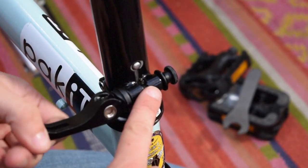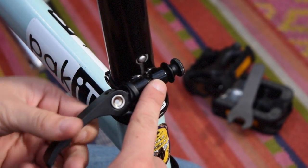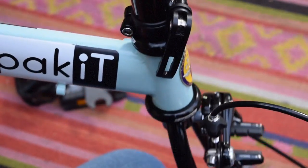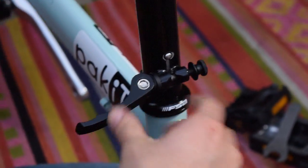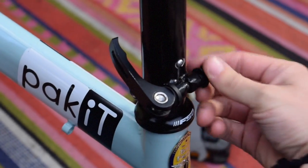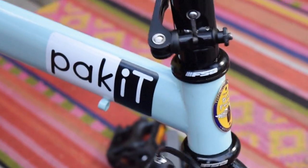Because the clamp is threaded, the direction the lever points will affect how tightly it clamps. Correct lever tension is critical, but you may find that this places the quick release lever pointed down, where it will strike the frame when the bars are turned. In this case, continue tightening the lever slightly until it is clear of the bike frame. Keeping the quick release's nut tight will help maintain adjustment each time you remove or install the bars while folding